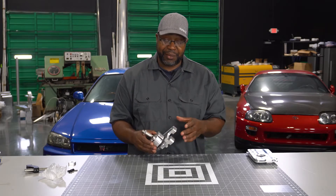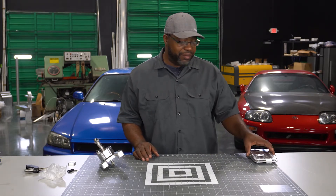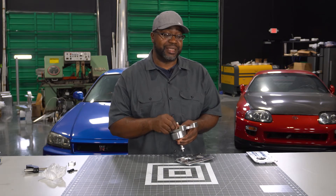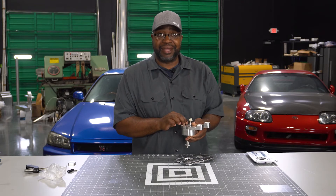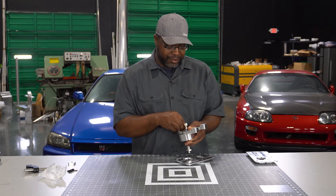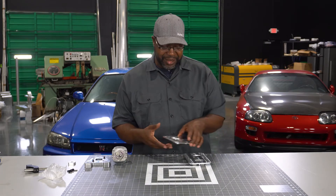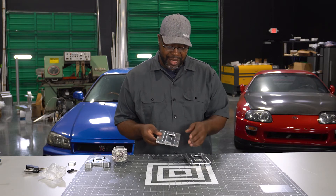The next step covers a couple of differences between the front mount and the rear mount. The major key difference beyond the looks is that the front mount is designed to go into the service cover on the transmission — the black composite plastic one on the rev match versions typically found on the newer 370Z and JK transmissions. Any rev match-based transmission will need the 370Z or JK style plate, which has a slightly different bolt pattern.